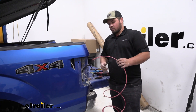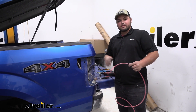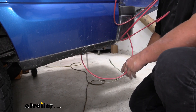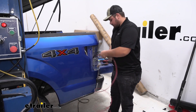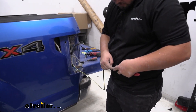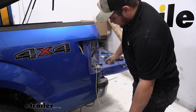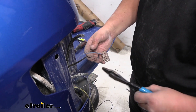Before we do anything else, we want to route up our wire. We're just going to take our airline tube — you can use a coat hanger or a string with a nut on the end — and drop that straight down through the rear of our truck and pull it out at the bottom. We can now grab our diode wiring, tape it to the end of our pull wire, and pull it back up to our tail light to work with. For our driver's side, we're only going to be using the brown and the yellow wire, so we're going to peel back our green and white wire and drop them back down through our hole. We're going to be using the blue wire and the orange wire, both with a gray stripe.